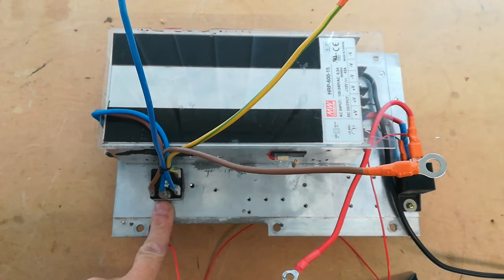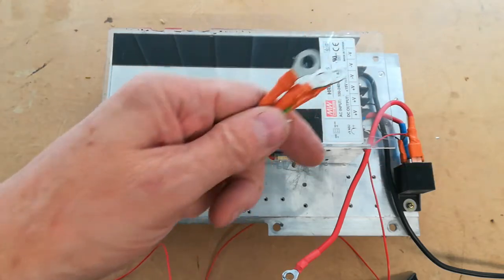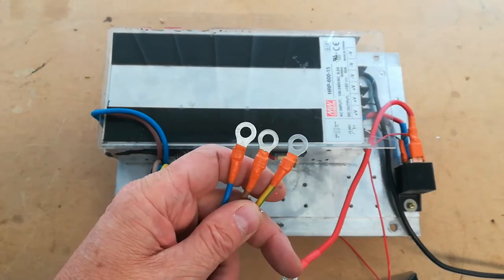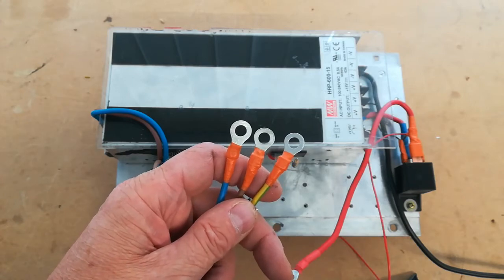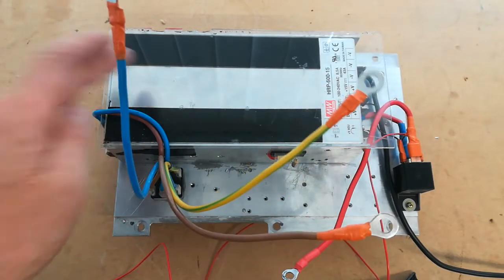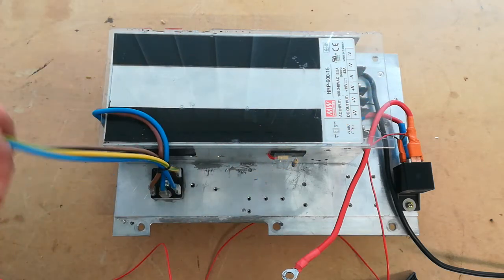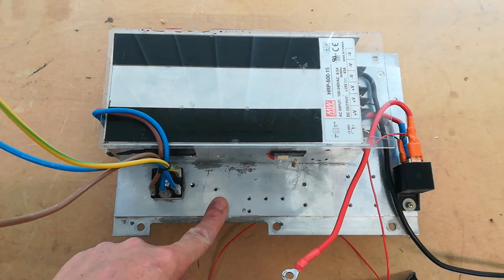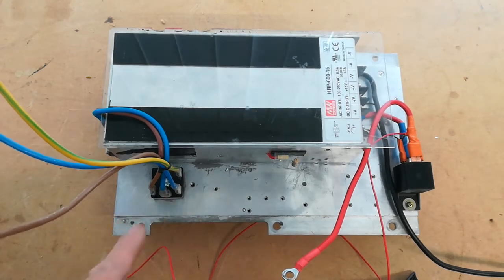What we have here is the three-phase to one-phase rectifier. You connect these three wires to the three motor phase wires that come back from the IMA motor, and that is the high voltage input into the DC-to-DC converter stroke power supply.